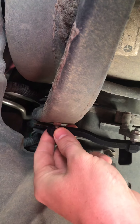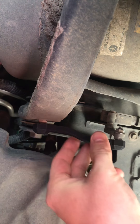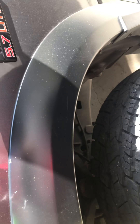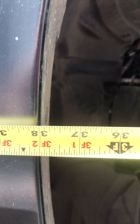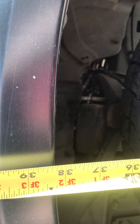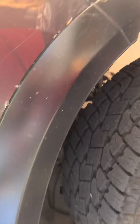I really like the stance. They are the Bora one-and-a-half inch spacers — super quick and easy to install. Just take off your wheel, pull off the little safety clips from the factory, put your spacers on. You will need red Loctite for the studs that come off of the hub.